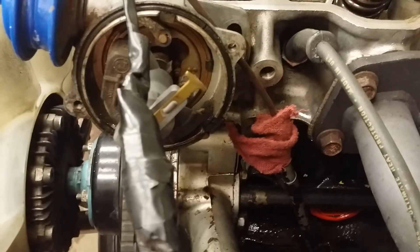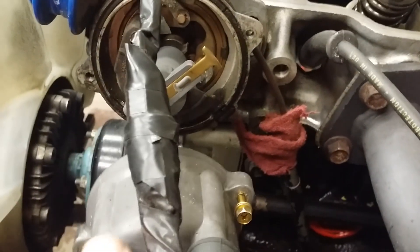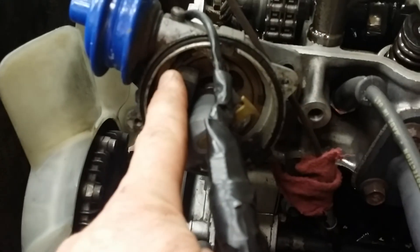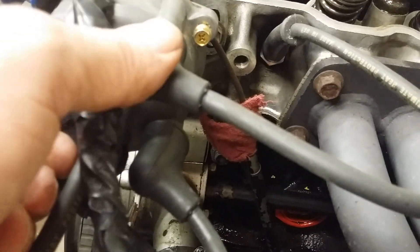Try to keep up with me because I jump around like crazy — it's just my brain. So basically what this is: this is retarded timing. When I tried to get it started when I first put it in, I had number one here. What I mean by that is this rotor button should be over here — that would be number one if I put the cap back on. This wire should go to number one cylinder. It did when I first set it up the way it was supposed to, but it wouldn't start. It was acting like it was really advanced, which it was. That would mean it's trying to fire here when it should be firing over here.